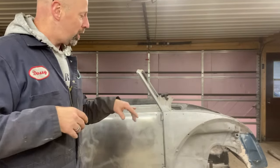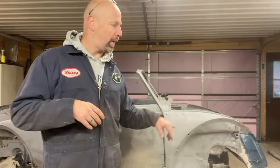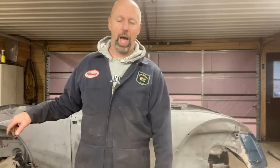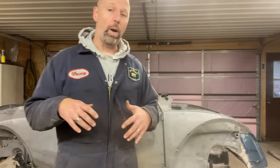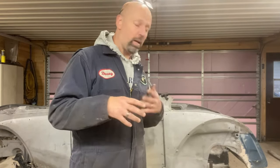And then I think what we're going to do is put the front beam back on and put the rear axle back in, set it down on rubber, and then take a third measurement. We just want to know how much adjustment does this thing naturally have? Can we get close to how it will be sitting when it's done and reassembled? And what does that do to the gaps? Do they not move at all? If so, that's nice. It's fairly rigid.